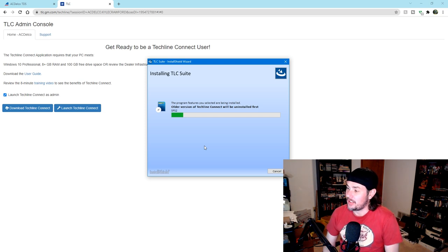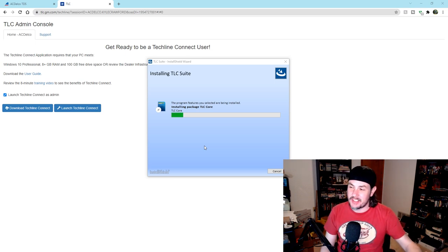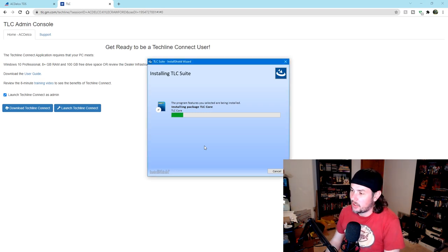You don't really have a choice at this point in time, but there are some very interesting things about this that we'll touch on as we go through it. Sometimes it requires you to completely log out of TDS and log back in and then relaunch it. It's kind of a pain. I'm not sure what's going on there. It probably has something to do with the authorization. Whenever you first log into TDS, you get an authorization to your account, and it has to be renewed in order to launch Techline Connect.